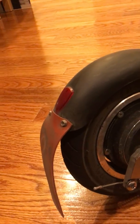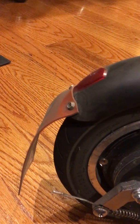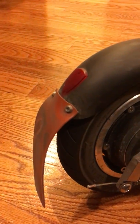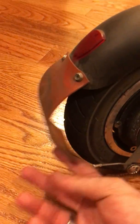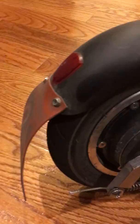Overall the build quality of this scooter is really, really great. There's also a rear mud flap — the rear fender isn't long enough to prevent rooster tailing. I've ridden this when it was wet and got a rooster tail going down my back. So I put this mud flap on, same rubber gasketing material as the front, with two nut and bolts on the inside and outside and a little contact cement to further seal it. It's nice and loose and soft so it doesn't get in the way or get damaged if it hits the ground — it just flaps back in place and works really well without adding much weight.